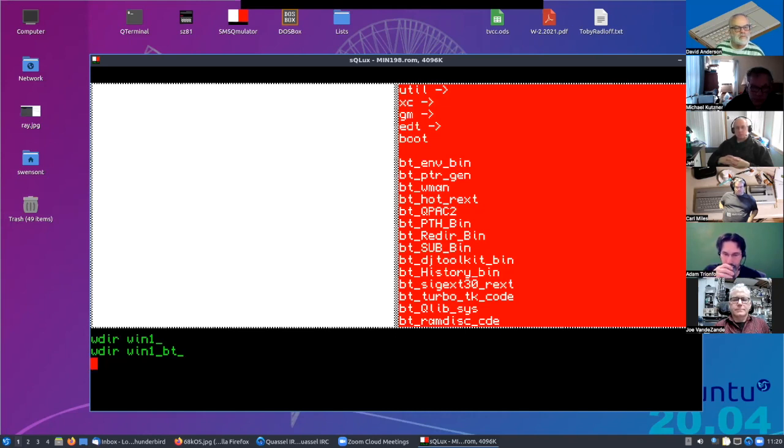Now you've got a USB thumb drive you can put in and maybe make bootable. That's what the ROM disk was. It was a flash drive you put in the back, and it knew how to be the boot. So when you boot up a QL, it looks for a file called boot on whichever device you've got. It defaults to MDV1, but with hardware add-ons like the ROM disk, it knew to tell the QL, no, boot on me, on the device. With the emulators, you can define where you want to boot from. And for SQLux, I've defined it to boot from Win1.